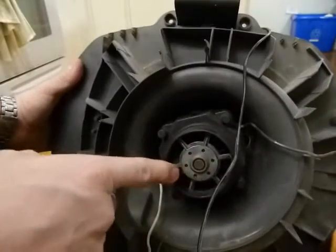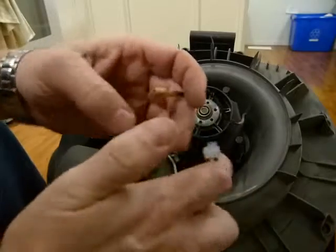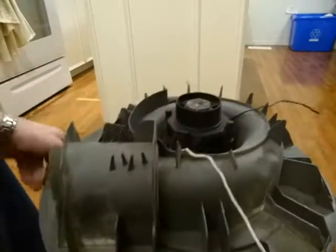This here is what's making the wind — this is the output shaft of the motor, and when it spins, another fan that you can see up top also spins. The only two wires that exist in this whole thing come to the motor: white on one side, and the black — the hot — with the blue and red connectors goes to the switch. You flip the switch, then electricity flows uninterrupted through the switch and the motor is powered.